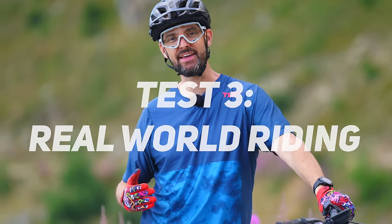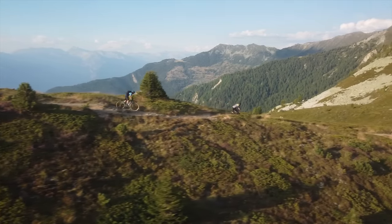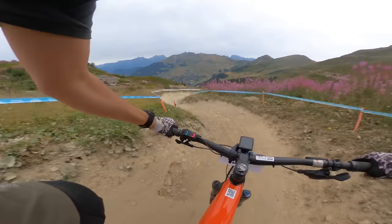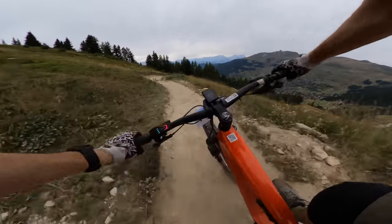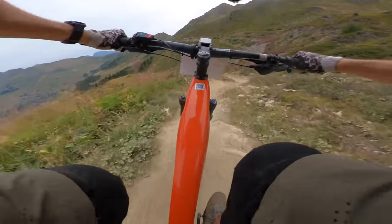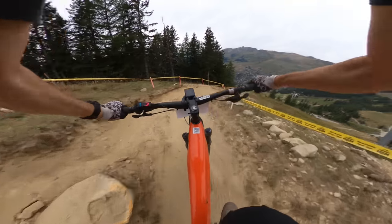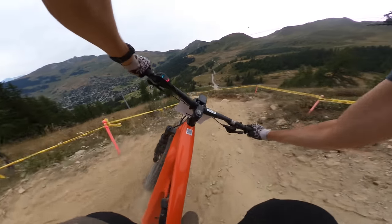I'm curious to find out: is it just a safety thing or will it give performance benefits on these trails? My plan is to ride the trail as I normally would, but with a little more speed before corners, braking hard going into them. Riding these trails, I tried to reset my expectations of ABS as purely a safety benefit and apply it with a performance bias — braking later into berms, using the front brake in the air when landing from jumps, and pulling the front brake over braking bumps and rock gardens. The more I trusted it, the more I could get away with, and I found I could apply 100% braking force 100% of the time.